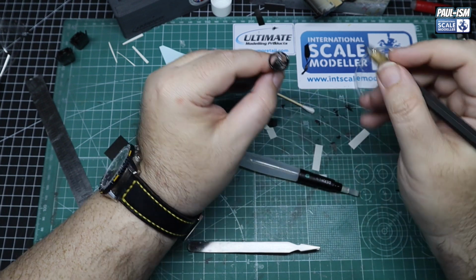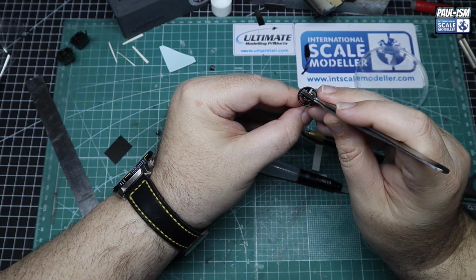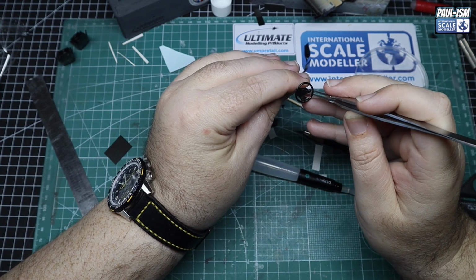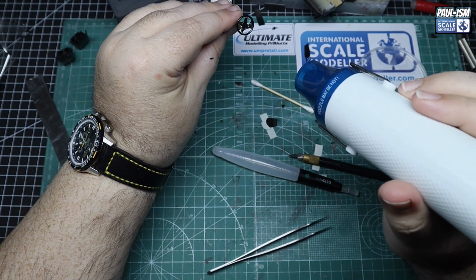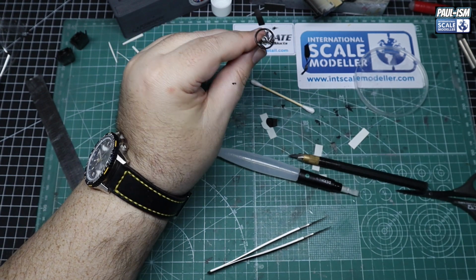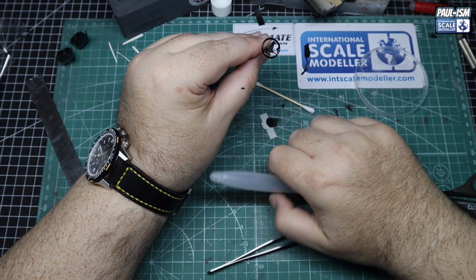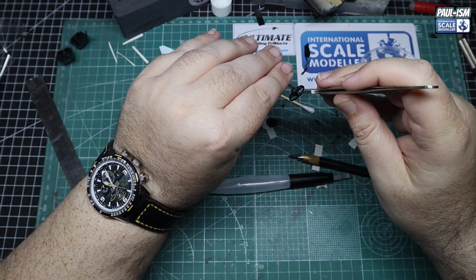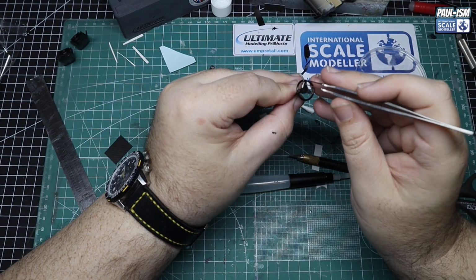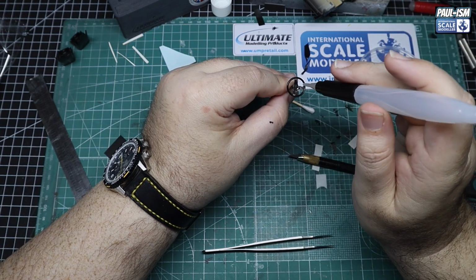There we go, get that extra piece of carbon off. As you see, it's already starting to conform. The decal solutions, a little bit of heat starting to really conform that decal round, and then a little bit of heat at the end. Don't put too much on. Your fingers are a good indication. If your fingers are burning, that's fine. Take the heat off. And then we quickly hit it with the brush again. Getting the excess carbon off. There we go. And yeah, quite surprised. Got this in one piece, first go. Quite happy with that. It looked really good.